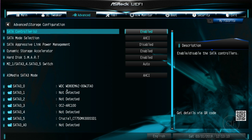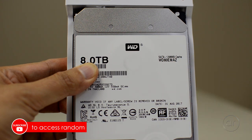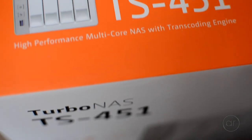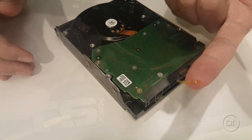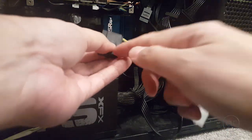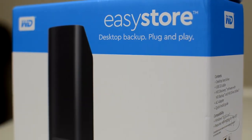Continuing to boot into Windows will allow you to see the disk and use it as normal. There are many power supplies which will work just fine with the white label drives, and my QNAP NAS devices work fine with them as well. But if you ever run across a situation where the drives don't power up, you can use one of these methods — the Kapton tape or the SATA to Molex adapter — to prevent any voltage from traveling to pin 3 of the disk, allowing you to use the white label Western Digital disks as internal drives. I hope you enjoyed! Thanks for watching!